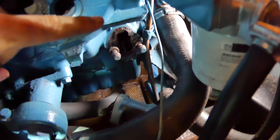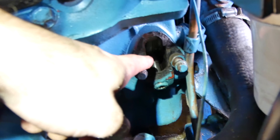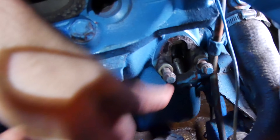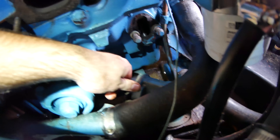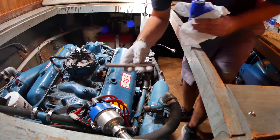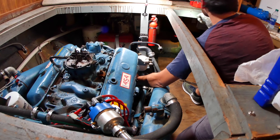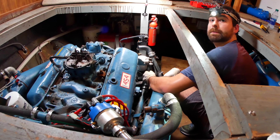Now is as good a time as any to get the fuel pump back where it's supposed to go. You can probably just barely see there's a rod — that rod is touching the camshaft up inside, and as it moves it hits a lobe and pumps the fuel pump. I need to pull out that plug, push the rod up, and get the fuel pump in. That's a little bit of a magic trick. Here's an idea: put some of this sticky assembly lube on the rod first to hold it up. And that is a fuel pump in place.